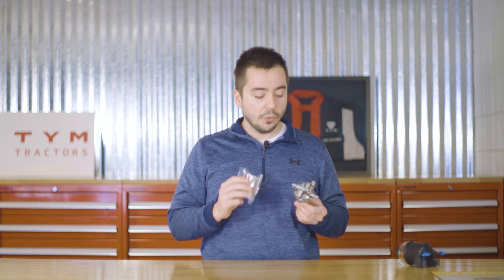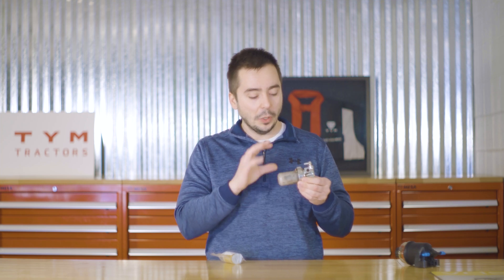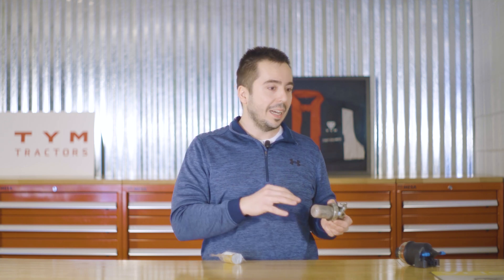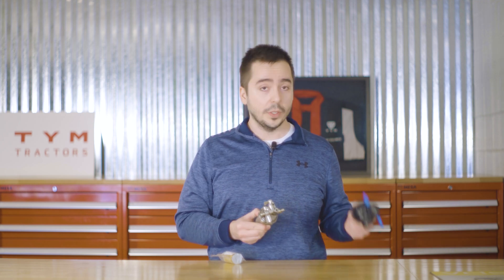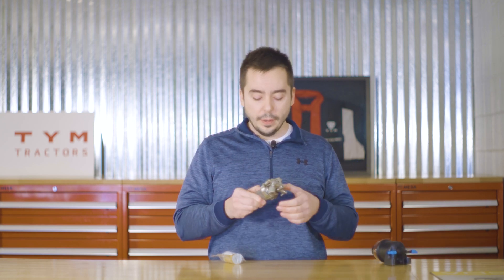This customer had a lot of water in this thing for a long time. We ended up replacing the whole assembly because there was so much junk and corrosion that we weren't sure the plastic itself wasn't breaking down or something weird wasn't going on. So we just replaced this whole thing for them. Something to touch on: this is not a warranty item of any kind — this is pure maintenance. The TYM owner's manual says to replace this and the filter in here at 500 hours. Now that's a perfect world scenario where there was never a drop of water that got in, or this was drained every day. Water is very corrosive when it comes to these fuel systems, so it ate this filter apart. This is plain old maintenance that was neglected.